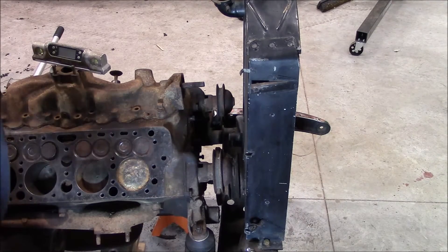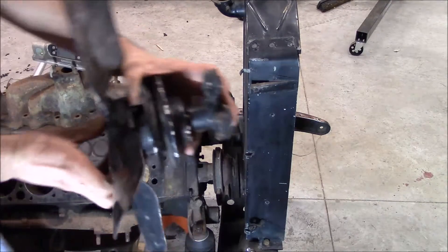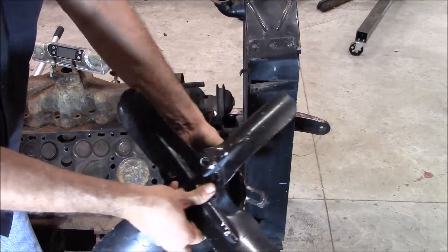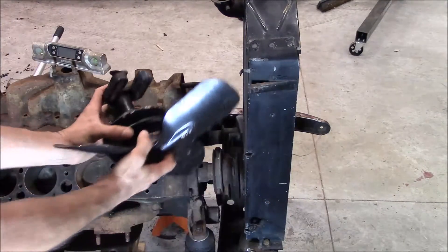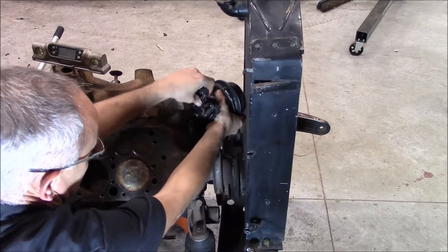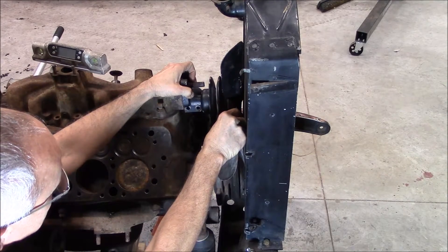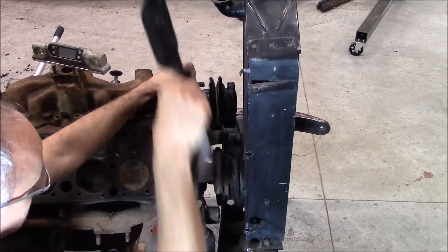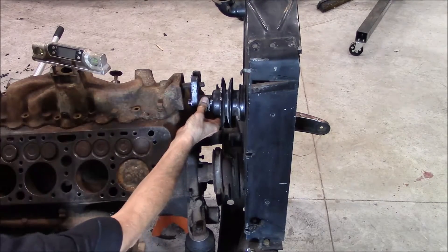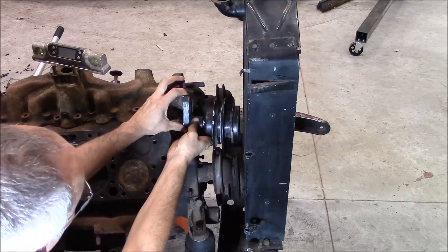So we'll see — if you guys are looking at it, it probably worked okay. What I have here is a fan assembly; it's got the wide pulley on it, says '21A' on the back, and the fan bolts on. Normally it's supposed to slide in under here like that and then the fan goes on, but there's just not enough room in the pulleys. Then I'd have to run a second belt, and the pulley being way out here would have to go out even farther — it's just too far, it wasn't going to work.